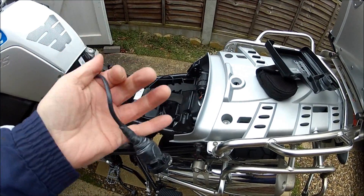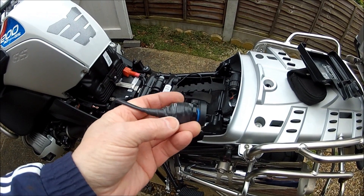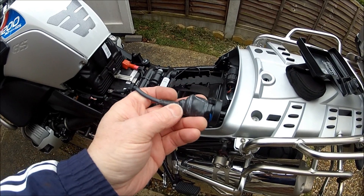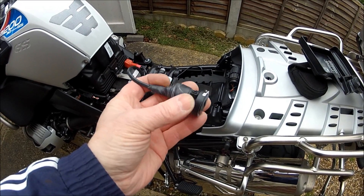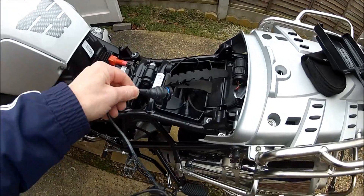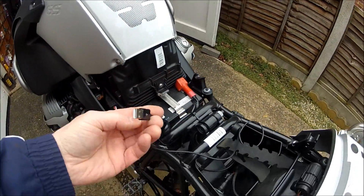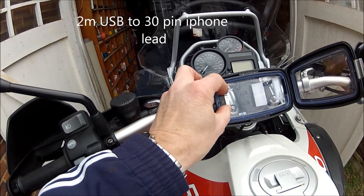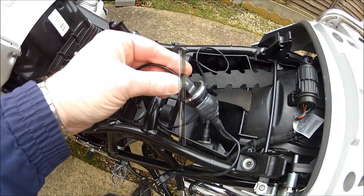Although I haven't done that on my old one and I haven't had any trouble. Anyway, there are two wires. You just wire up and solder onto the earth — that goes onto the sleeve when you put it in your car. Then you solder the other point onto the positive. It's just two wires, just solder it on. Wrap it around with some amalgamated tape and a bit of tie wrap. It doesn't look pretty, but it's just to stop the water getting in. Slot it in there and just plug it into your lighter. Then all you do is get a two-metre length of USB 30-pin cable for your iPhone and just wire it through and connect it up. Job done.